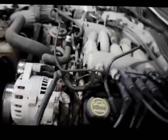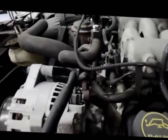Let me go inside and cycle the key two or three times to see if we can build up any fuel pressure. We just turn the key on and let it stay on for a couple of seconds because the pump should run for about five seconds, then shut it off and turn it back on again. I don't even hear the pump running. We tried pressing the Schrader valve again and we have no fuel pressure in the line whatsoever.